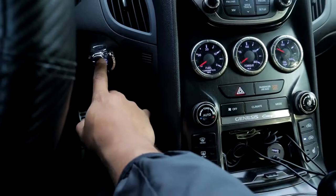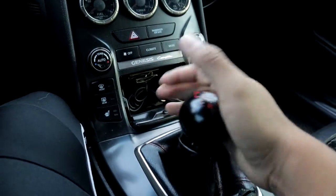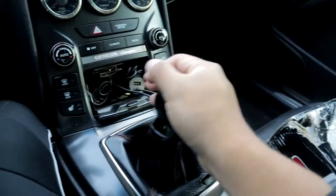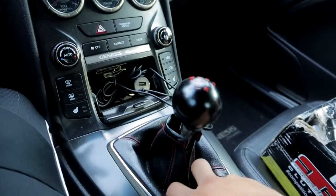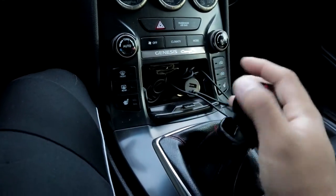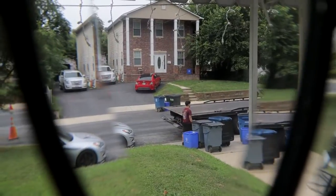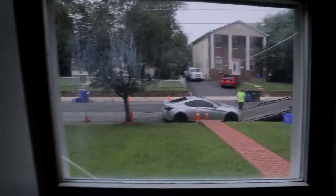People said it was the clutch and throwout bearing. The only way I can actually drive it is if I turn it off, put it in second gear, then turn it on — but I can only leave it in second gear because after that it won't lock into any other gears. I also ordered a short shifter but it didn't come in time to install with the clutch, so I'll have to get that installed another day. After two or three hours the tow truck finally came.